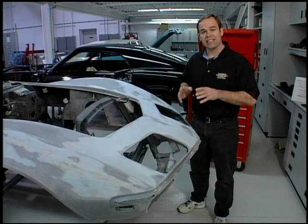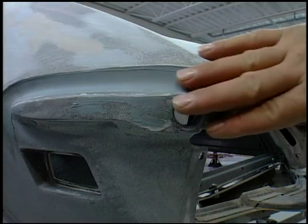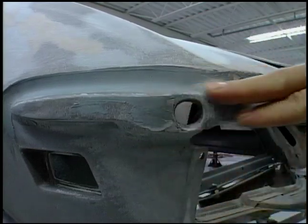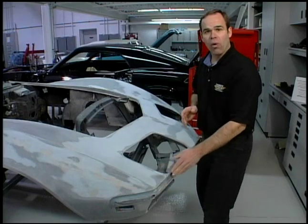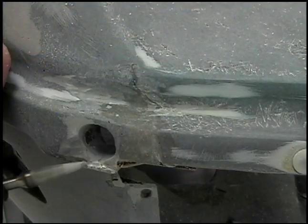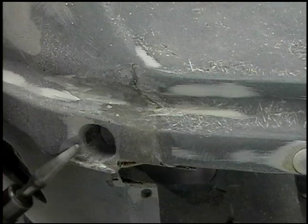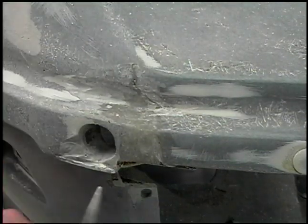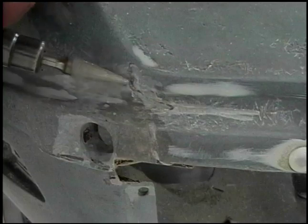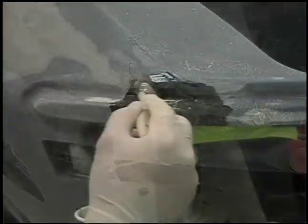But there are lots of little stress cracks and lots of little areas that need some attention. One of those areas is typically where the front bumpers would bolt to, and lots of times the bumpers get tapped slightly and they create a stress crack or even create a hole. On this front corner, what we had to do after we got it back from the blaster is we had to dig out the original body filler — you V that out with just a little Dremel and keep working on that area until you've got all of the body work out of there. You can't lay fiberglass over top of body filler. You have to get down to the original fiberglass. Once that area is nice and clean, keep blowing it out so you don't have dust in there, then you start to lay in the resin.